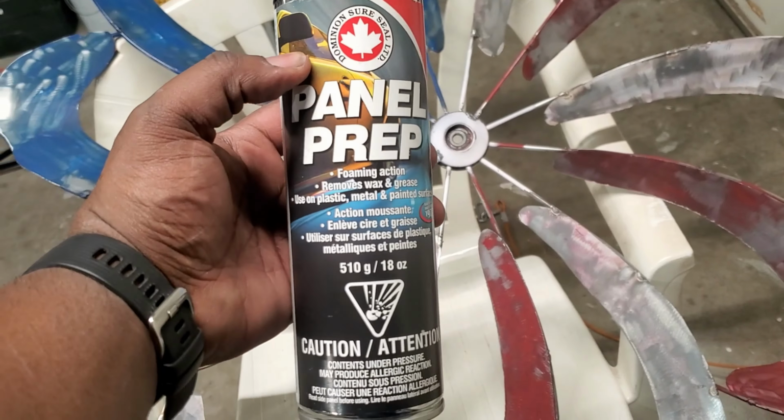Okay, so right now we're sanding with 320 dry sand. I already put some guide coat on it. Kind of already got started. Got some low spots. This is the back of it. I'm not too worried about it. Got a lot more to go. And got the grill going. Yeah, buddy. Stay tuned.